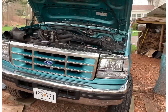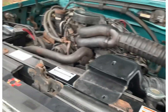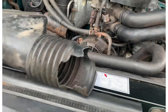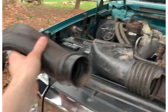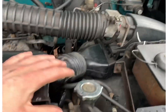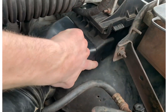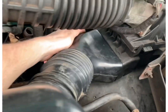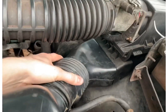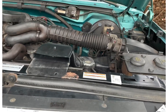Alright guys, so we're back here at the truck now. We just got the new intake tube put on. From the looks of it we could have just replaced the back part — you can see here where the old one was all chewed up where it connects. The old one's still intact, but we got both of them from the junkyard so we just threw the whole piece in. All we had to do was pop off a clip here — one was already missing, so that made it quicker. There's a push tab here and a push tab on the far side; you just get a flathead screwdriver and pop those in, then this old tube comes out. Disconnect there, and then the new one pops right back in. Good to go.